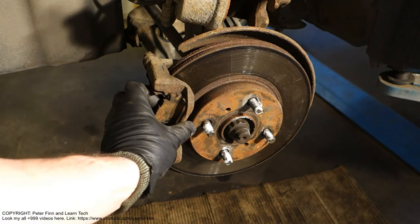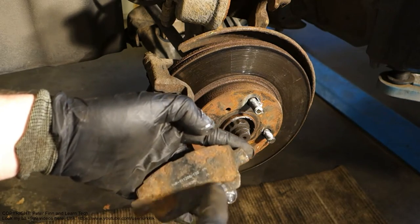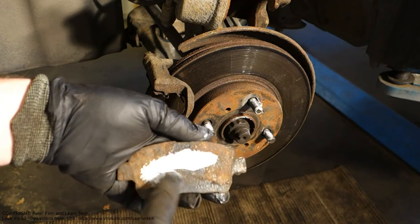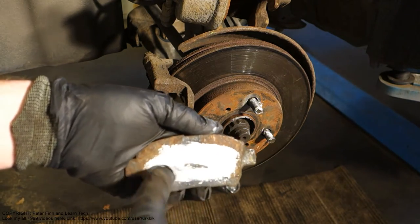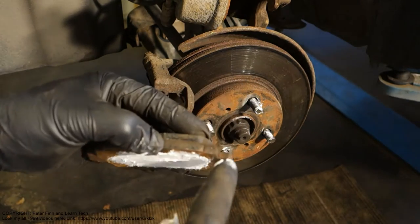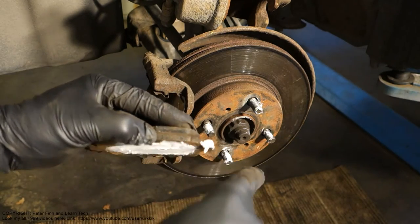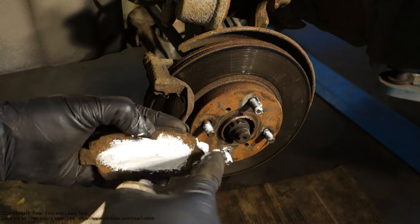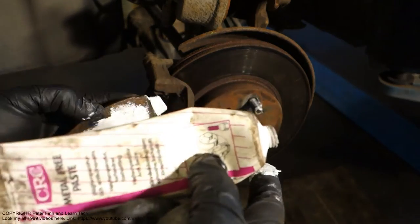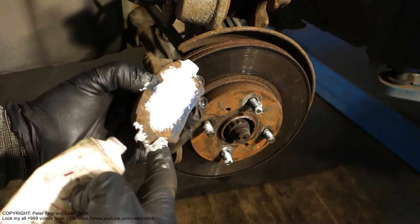First, when we take our brake pads, the normal area is always this area in here. In that area, I can insert my grease in all areas. In that outer area, remember, only outer, not this inner area. And then these upper holes in that area, I can insert this specific grease. There is also some other grease that is suitable, but at that point I can install this grease.